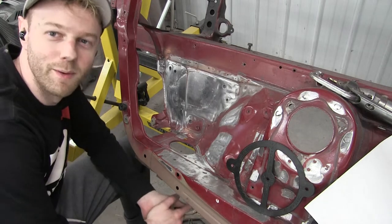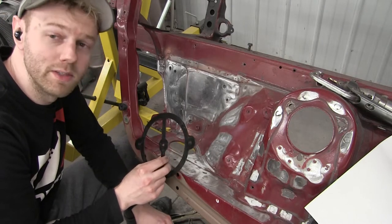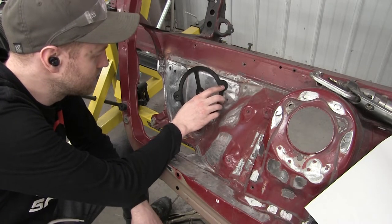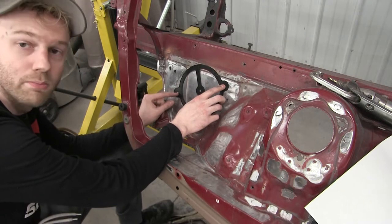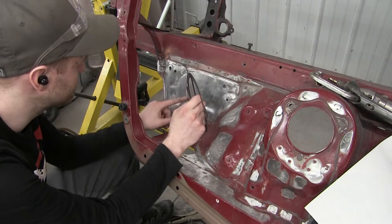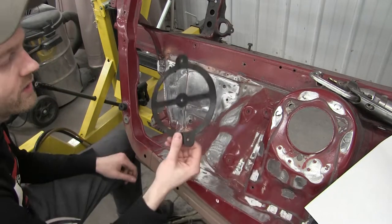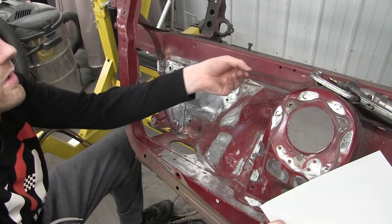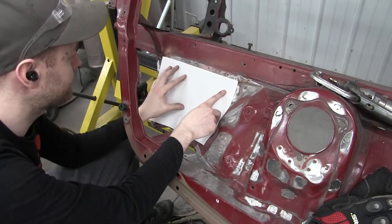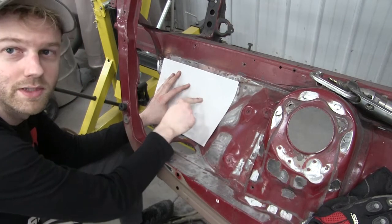Okay, so what's up? We got this template from Powerhouse Racing. I'm pretty sure I covered that earlier. Can't remember, it's been a minute for me. It's probably been 30 seconds, whatever, for you guys. Anyway, that mounts here to this bolt, but there's usually a second bolt that goes right here for the battery tray, I think, or something like that. And that was cut out previously. So now what I'm gonna do is actually make a template of this on my car. And then we're gonna make a white piece of paper or whatever, line up some holes that are the same, go to my car, make the template, and then come back and we'll have hopefully where we need the hole to be for the intercooler piping.